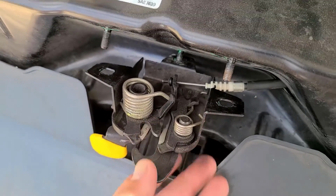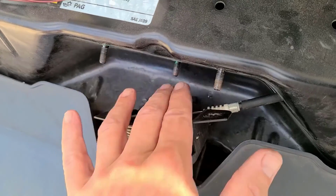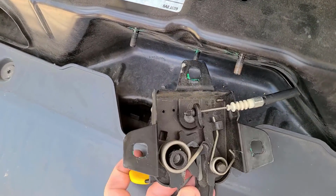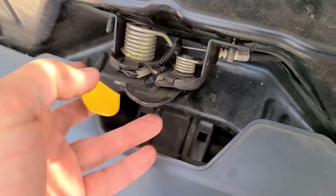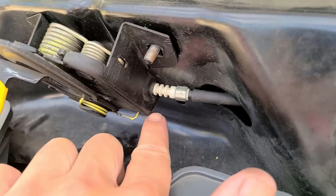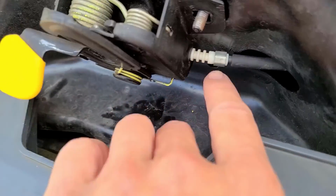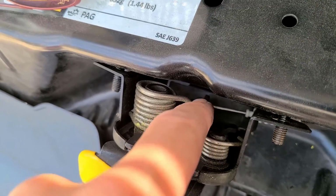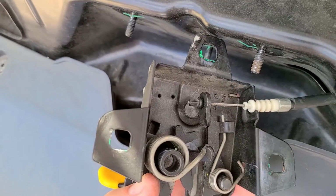So I started taking this guy apart. I pulled the screws. There's just 3 mounting screws here, and then I started looking around inside. The original idea was to drill a tiny hole right here. I wanted to make it as low as possible so that I would get the most leverage on that lever arm there, because you can see the factory one is installed pretty low, right?